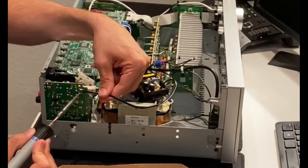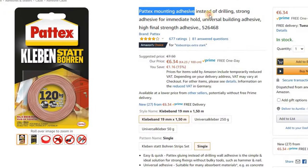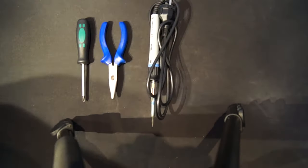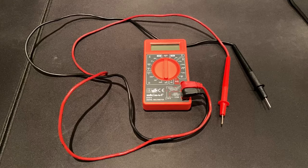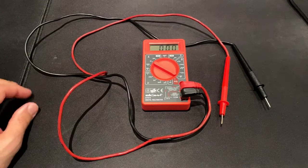Cables for extending the built-in fan, branch terminals, and plug pins for connecting the fans are required as additional accessories. Furthermore, double-sided extra-strong adhesive tape and glue are required for fastening. A plastic housing is used to accommodate the switching power supply unit. The required tools are: a cross-head screwdriver, pliers for pulling plugs and stripping cables, a soldering iron and soldering accessories, and a voltmeter for measuring voltage and polarity. Links for the components and accessories can be found in the video description.